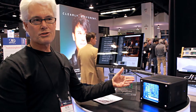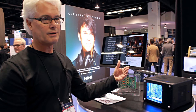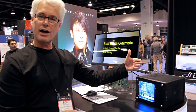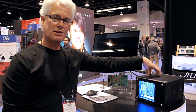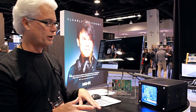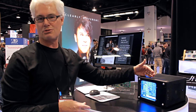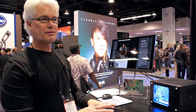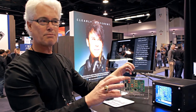I know a lot of folks are concerned about putting PCI or any audio cards inside of a computer. This is an example of some of the grounding and shielding techniques we use. The power supply is actually right behind the PCI Express card here, and I do a lot of measurements to make sure that we're maintaining transparent sound and absolutely the lowest noise floor. I can tell you that with this card and the chassis right next to the power supply, there's absolutely no interference or emissions from this power supply getting into the audio performance of the card.